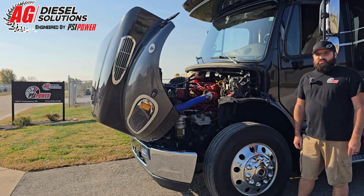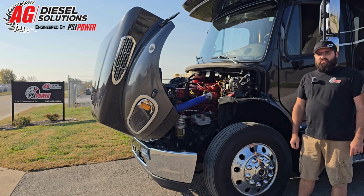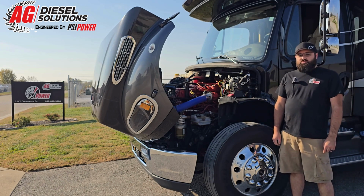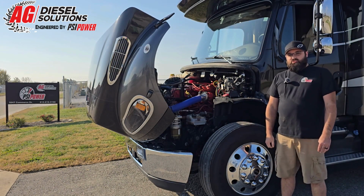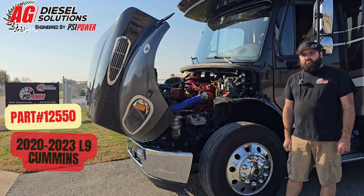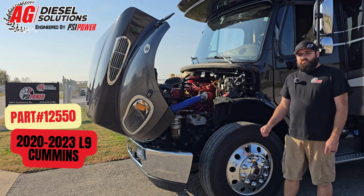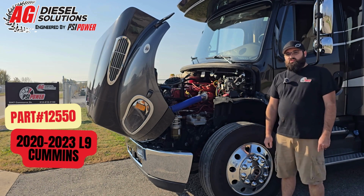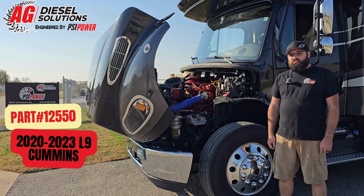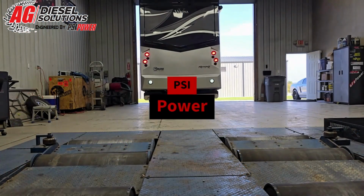Today we're going to be working on this 2021 Renegade Verona motorhome. It's equipped with the L9 Cummins and an automatic Allison transmission. So we're going to be installing one of our Ag Diesel Solutions part numbers, being a 12550. This is going to fit anything from a 2020 all the way up to a 2023 L9 Cummins. This engine is rated at 360 horse at 2200 RPM. So today we're going to install the module, put it on the dyno and see what kind of horsepower numbers we can get out of it.